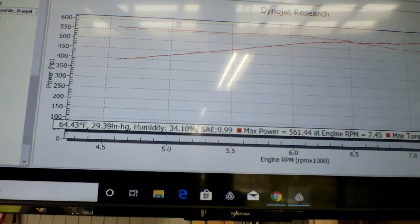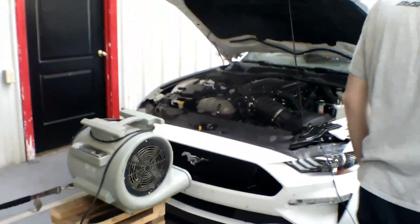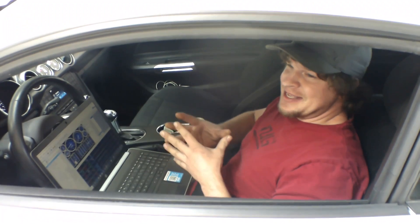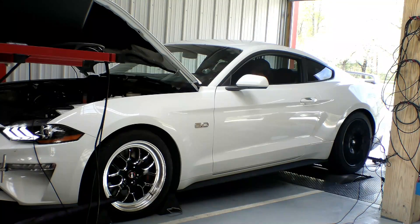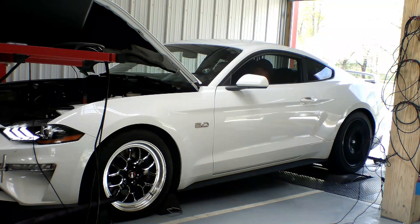To see the difference that four degrees of timing makes — it will be capped at 14 degrees and will not go past that. I'm expecting around 616 to 650 horsepower. Just finished the dyno pull on 14 degrees of timing. You can see it revved up to 7,500 RPM, timing locked out at 13.8 degrees, throttle body open, and fuel trim looking good. Let's see what it made.